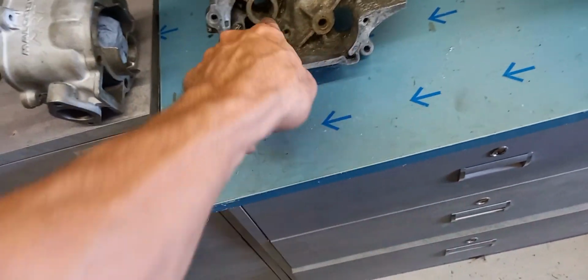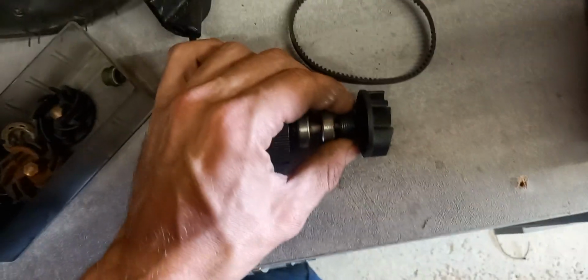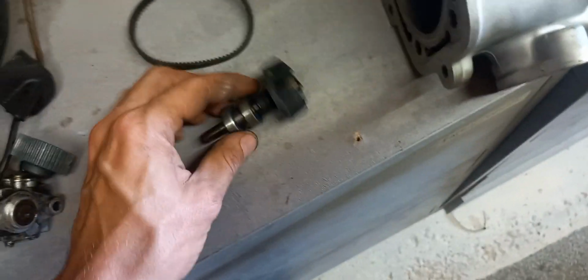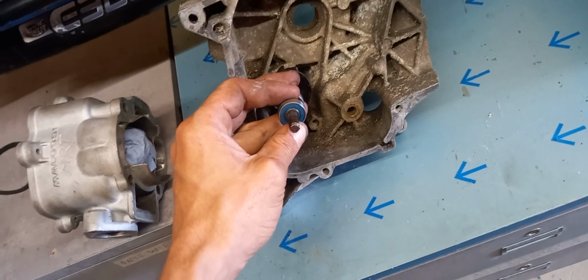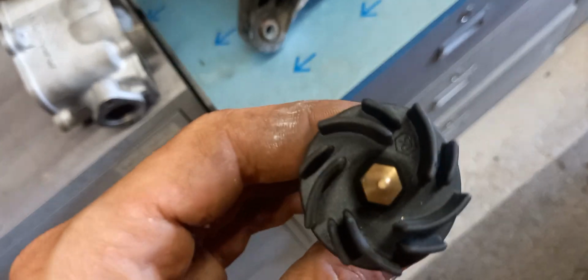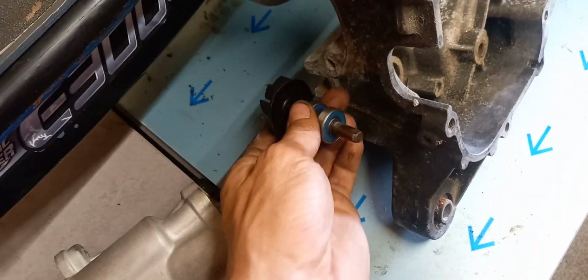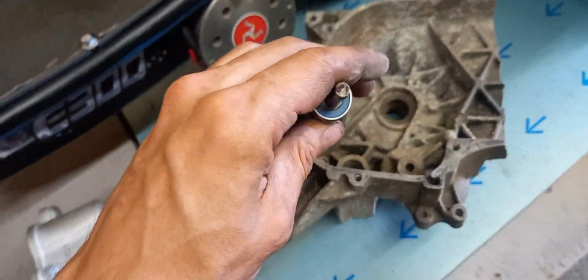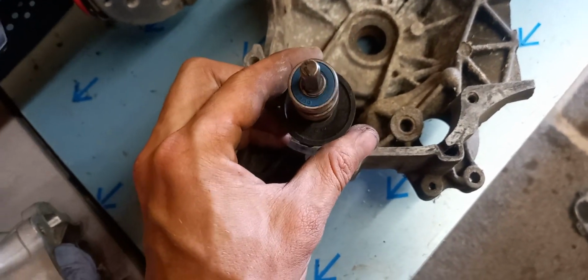If ever any water leaks out there, you know it's the water seal. It's not actually a hard fix, because all of this removes anyway, and you're left with this sticking out of the engine. Now if you take the other side of the water elbow off, put a little 8mm socket in, because that's in the other side, as you can imagine, it just sits in there. Then you just put a pair of grips on the square edges of this, and you can undo it. It's left hand thread as well, so it's do up to undo.